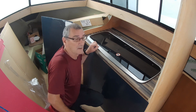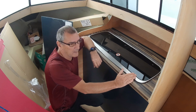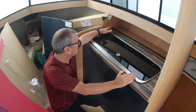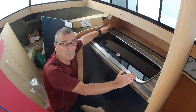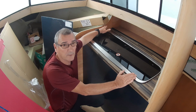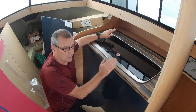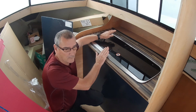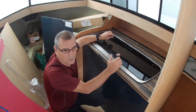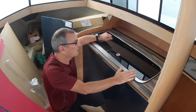Hello and welcome back to A Little Crazy. I've got quite a bit of work to do around this galley area. I've got to put the electrics in for the small reading light on the other side of this board, put in a small 13 amp single socket with USB, do the electrics for the fridge, the gas for the cooker hob, the electrics for the water pump, and any other things that need wiring up.